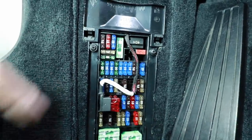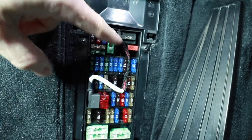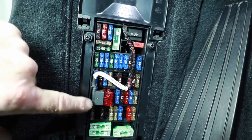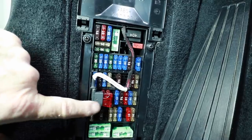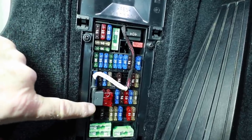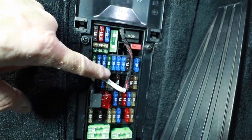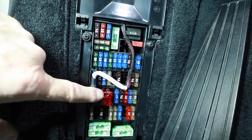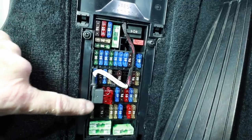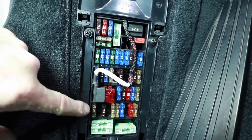Here's what the fuse panel looks like. We found the accessory fuse located all the way over here on the outside. We used our double fuse tap, labeled it accessory, covered it in braided loom, and it snakes out through the top of the fuse box so the cover goes over it flatly. If you're using a fuse tap like this, make sure you use it properly. The end where the power source is must be the end in the fuse. If the power source is here, the wire comes out the top — that allows power to come in, pass across the fuse, and out to our device. If the power source were on the other side, it would bypass the fuse entirely and the circuit would not be protected. You can verify with a digital multimeter: put your positive test lead into each terminal with the other lead to ground, set to DC, and see which terminal has the power source.